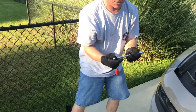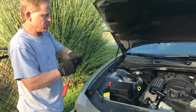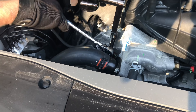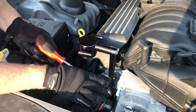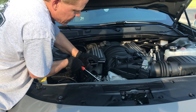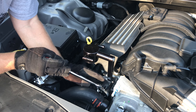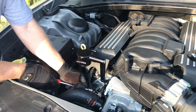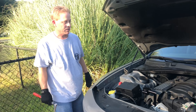You just need an 8mm socket and a ratchet. Actually, I'm sorry — it's a 12mm socket that you need, not 8mm; it's an 8mm bolt. We'll just make sure that bracket's straight up and down, position it like we want it, and snug it up tight. It's easier if you have a deep well and a swivel head socket so you can swivel it out of the way and not worry about hitting any of your top pieces. It doesn't have to be super tight, just enough to keep it from moving.